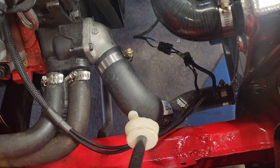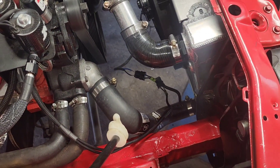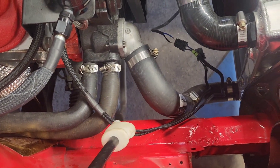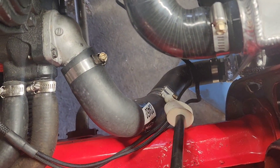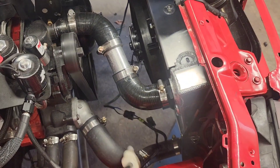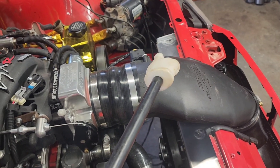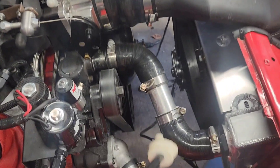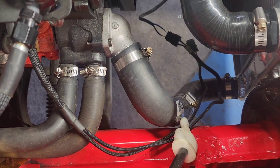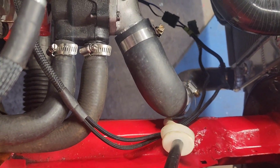The biggest thing was the lower hose — the part number is Gates 23460. I went and looked to see which ones I thought would fit. These were 180 degrees off, so it was turned over here and it fit that way but there was a weird kink in it. So I cut it and put a piece of the CX Racing upper and lower radiator hoses I got from eBay. The pipe that used to go over there I cut, so there's a piece of it in here. I cut that, turned it, and this fits all nice with plenty of room. When I take this off I'm going to trim it a little bit to create more of a gap — it's kind of close but there's plenty of room.